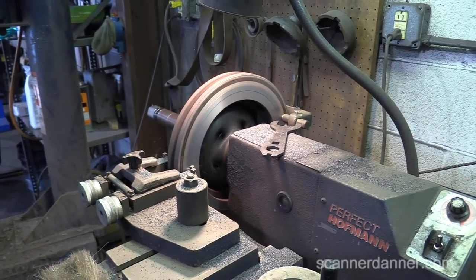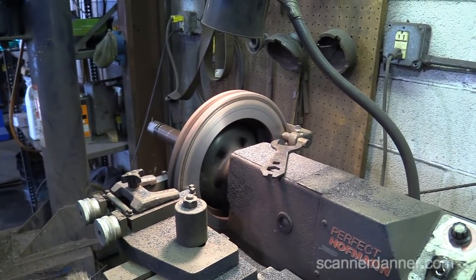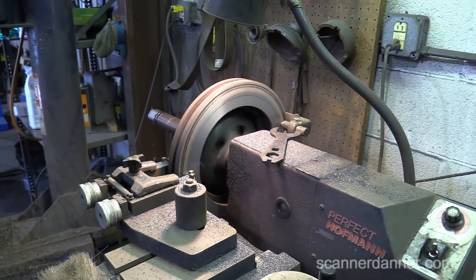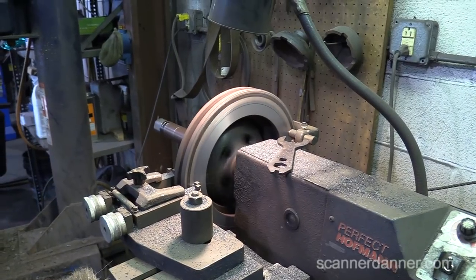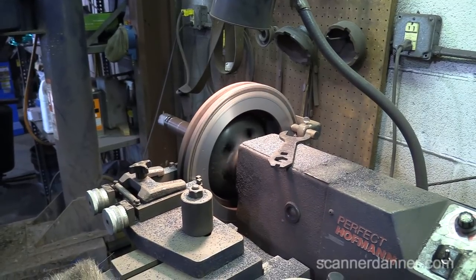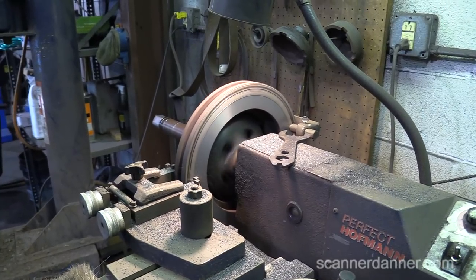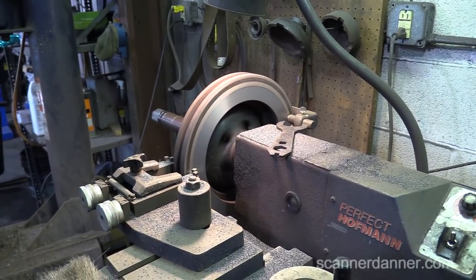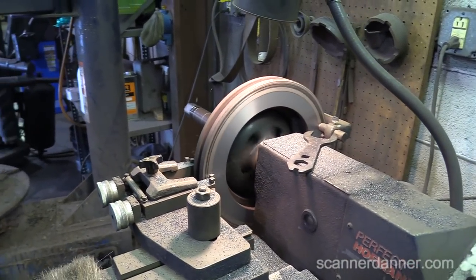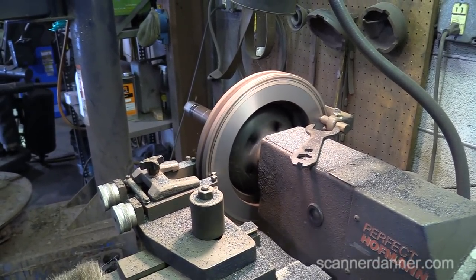See the importance of not putting new pads on this rotor, Caleb, after now seeing how messed up it was. That's why you don't do it. To slap new pads on an old rotor without a clean surface is foolish. It's not a proper brake job. So you either A, cut the rotors, or B, replace the rotors. That's it. Otherwise, don't put the pads on it. And that's why I'm not doing anything with the rear pads on my truck right now. There's still plenty of lining left, and I'm not going to change those without doing something with the rotors. Is the point? Yeah.